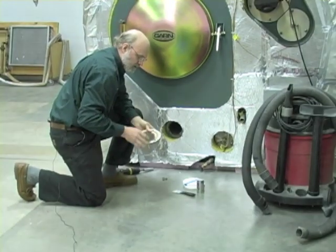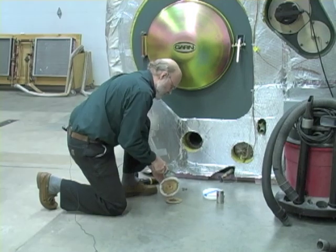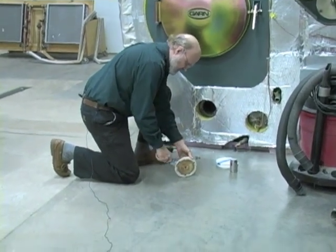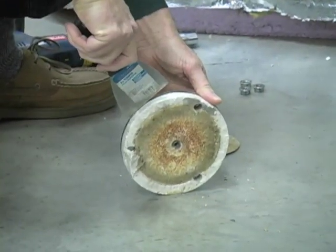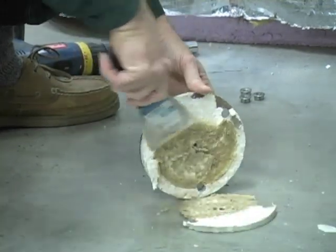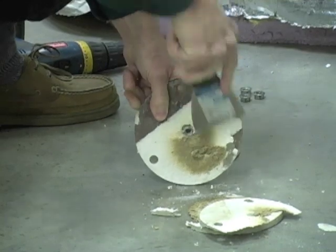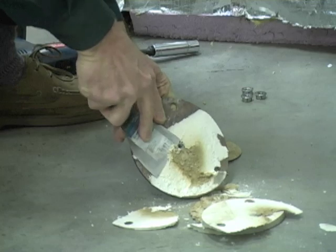This is the old heat shield and cover plate. To clean the gasket and get it off you'll need some kind of a putty knife. These will adhere sometimes to the cover and sometimes also to the paint on the unit, and it's important that you get all that off so you get a good seal once you put the thing back together. This is what keeps any particulates from coming out into the room and any kind of carbon monoxide or carbon dioxide from leaking into the space.